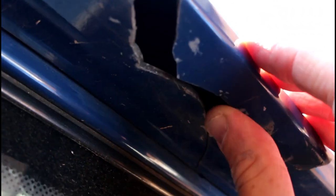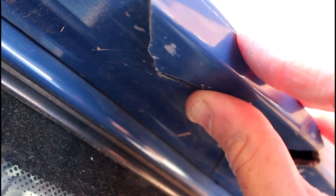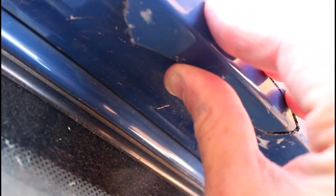Just been fiddling with the crack in the spoiler and this happened - the damaged bit fell out, which I'm actually quite happy about. I can pull this back, get that glued back in, sand this down, glue that back in there and then obviously add some filler. It's the way it's snapped - it's just a little bit too big. If I can sand that down properly, I should be able to get that stuck in a lot more level than it was.